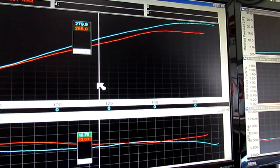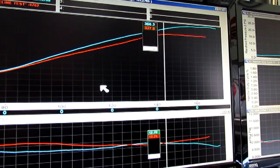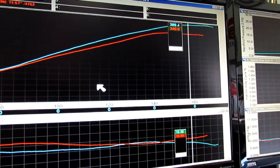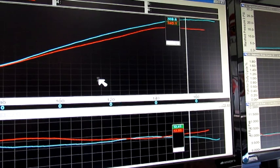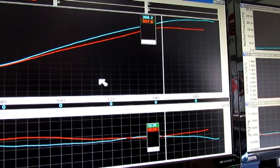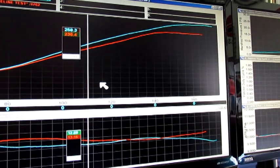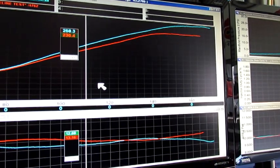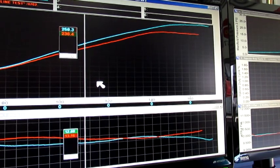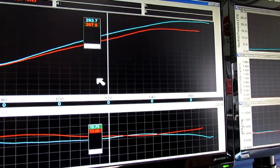The added bonus out of tuning and the right injectors and that sort of stuff is, as you can see, we've got some top-end horsepower as well. There's a little bit in the fact that the belt wasn't set up properly, it was doing a little slipping, but really what it comes down to is it's made more horsepower all over the place for what in most cases people would think is a lesser setup. It's just a single throttle standard intake manifold, and we've actually removed the twin throttle and made more horsepower and more torque, so this should be a lot better to drive on the road.